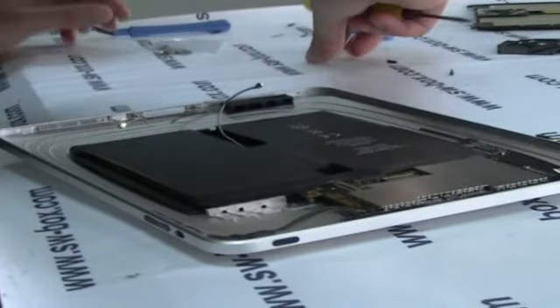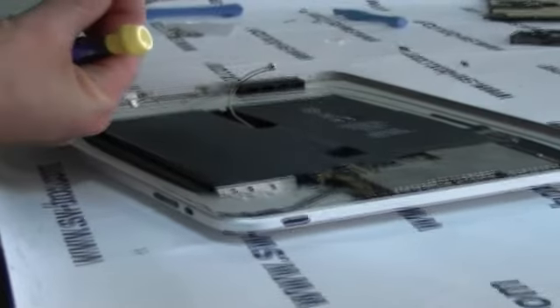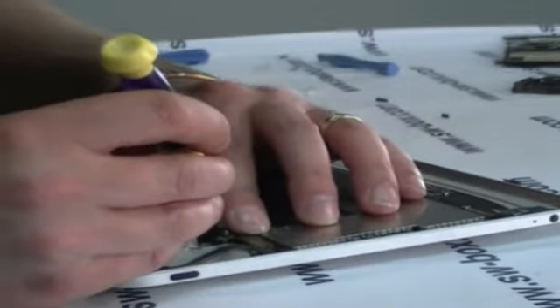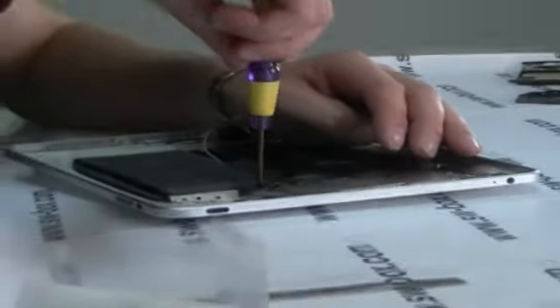Some devices it seems like at the factory they must have used some robot to screw it on so tight it's impossible and you find yourself stripping the screw. But not the case here — they're just held into place. If you look, they've got a little blue tinge on them — that's called lock-tight, which holds it like a glue. It sits around the thread and holds it in position, but you don't need it. I think it's more what they like to do rather than what's necessary. I haven't done it up tight — I've just done what needs to be done.